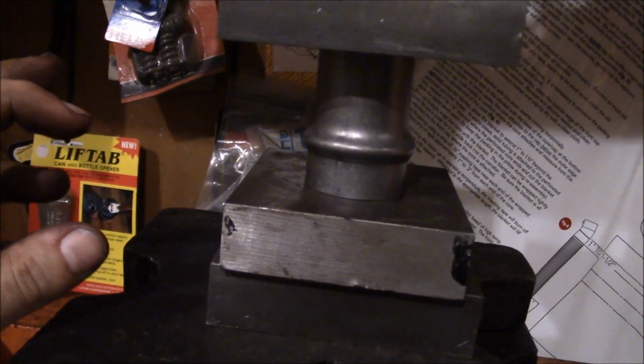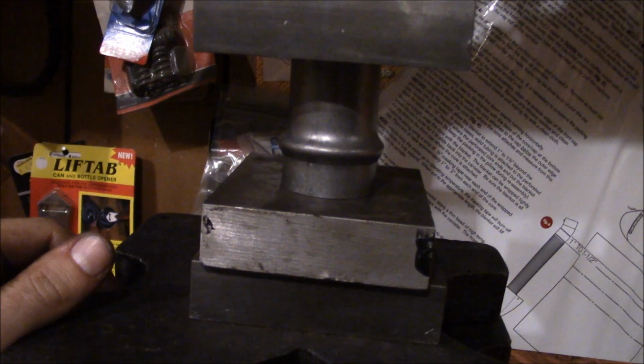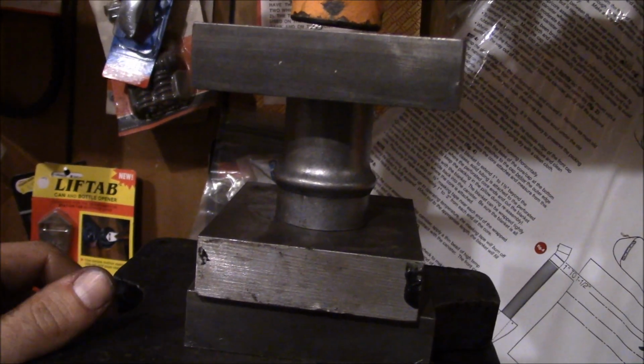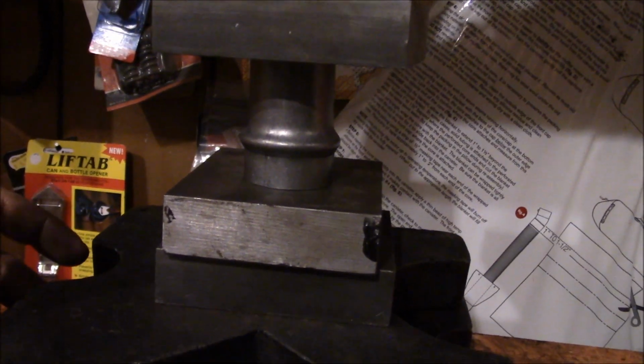Crush it down just a bit, so you still have to preload it with the nut, but start it with a press or heck, a hammer or something. But it takes a ton of torque, a ton of force to get this thing moving. Well, more than that, my 20-ton press has a tough time getting this thing started to compress. Once it gets going, it's a lot easier.